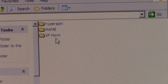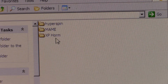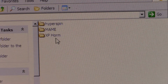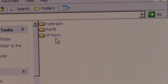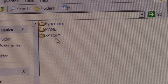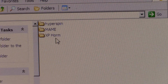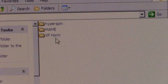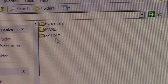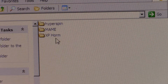So what HORM does is, when we activate it, it takes our hibernation state that we were in and protects it. So what this means is, if the computer crashes or the power gets lost in the middle of us playing a game, when we resume power, when we turn it back on or the power comes back, the hibernation file will not be corrupt at that point. It'll still work, and it won't prompt us to fix the hibernation or boot from a fresh start, basically.